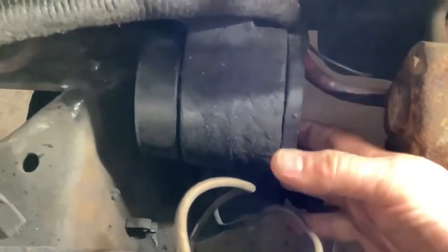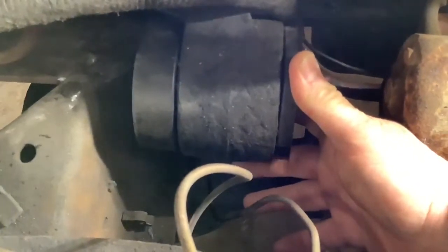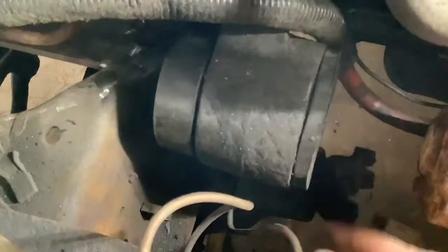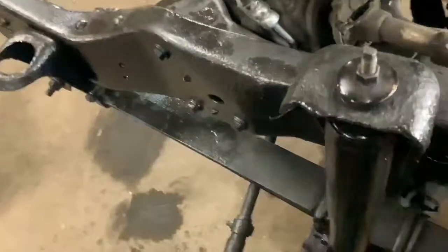I have made some measurements and this is four inches, so we have a piece of 3/8 by 4 inches wide steel. Both ends will get the same — the mount will be flush here, and then I will build off this mount. I'll tack everything and show you what I have before actually welding them in. It will come off this plate, hook to here, put it in the drill press, drill the holes when we find the center. Same way on this one.